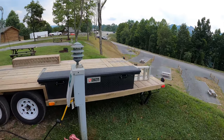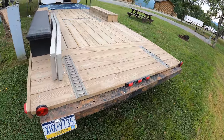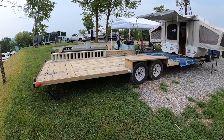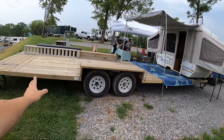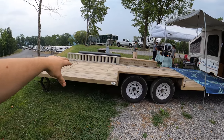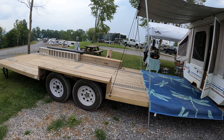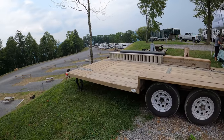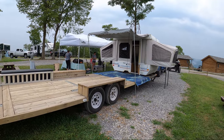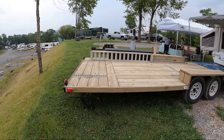The trailer started out as a 25-foot Terry camper from the 1980s. We bought it, brought it back, tore it down to the frame, gutted everything, rewired it front to back, reinforced the frame, and added steel channel and flat bar to widen it to eight and a half feet so we could fit our machines between the wheel wells. We used it as a regular trailer for about a year before deciding to add the pop-up.